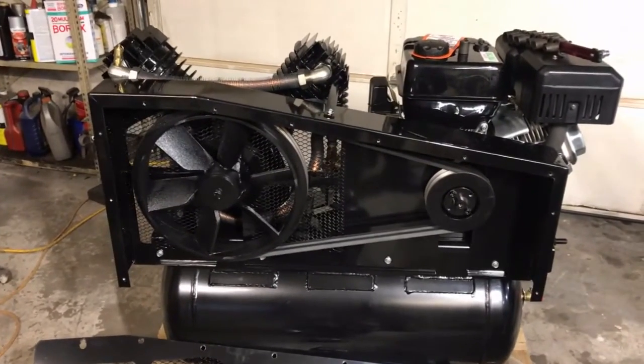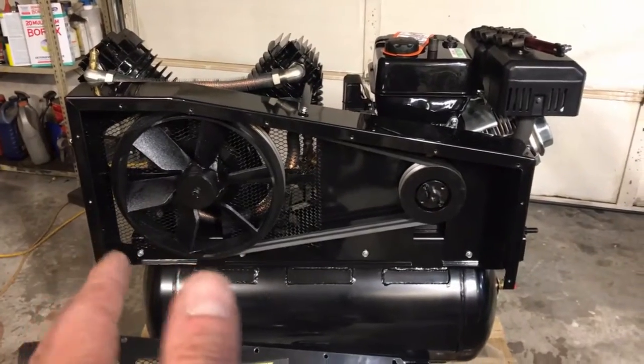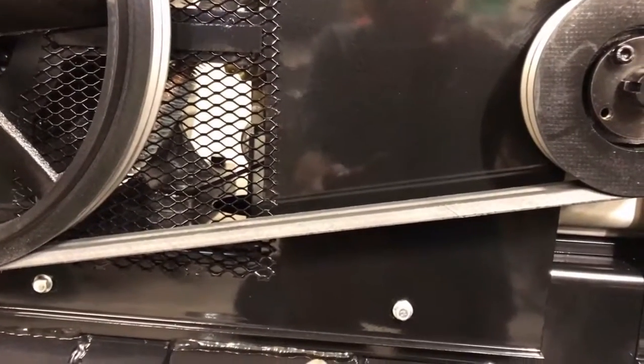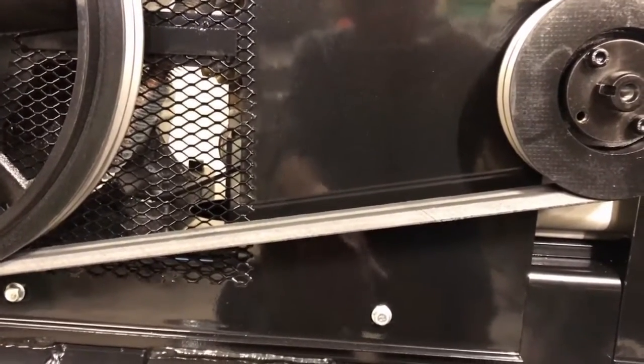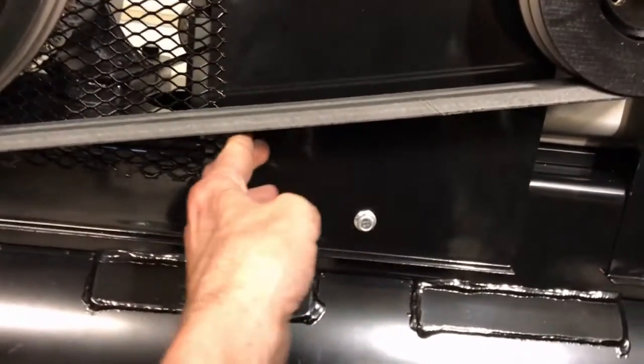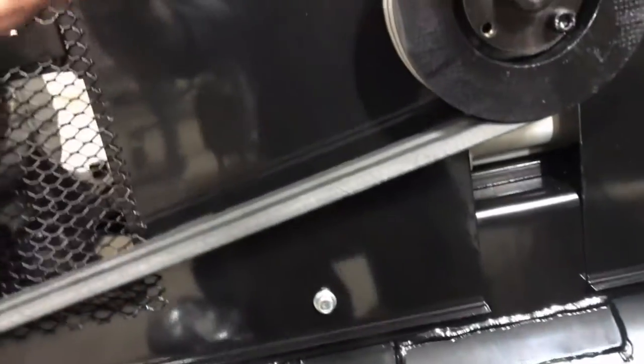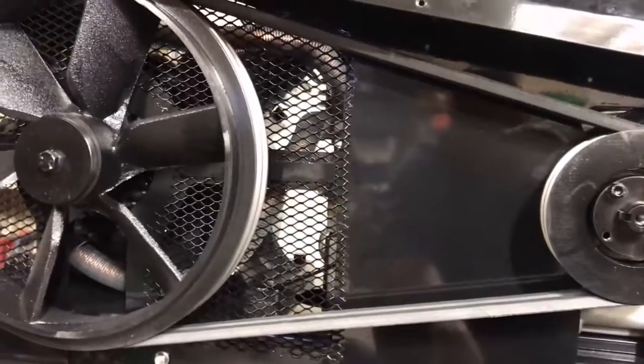Get a load of that. If any of you guys out there are familiar with the process of determining belt tension, let me know what you think. From what I remember, you're supposed to be able to put a force of 20 newtons on this belt and get about one centimeter of movement — that's way more than 20 newtons. This is a very stout tension. I don't know how much I like that, and seeing as how they've got these new tension features, I often wonder if the guy at the factory gets a little carried away.